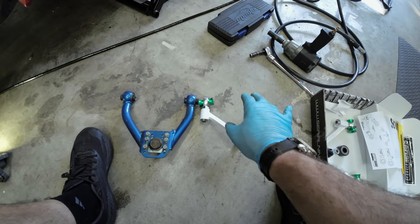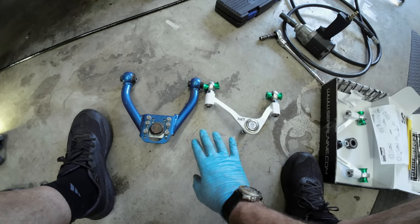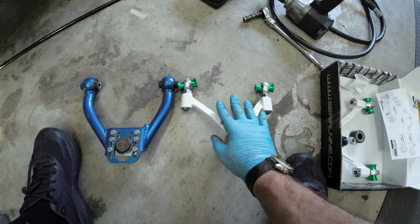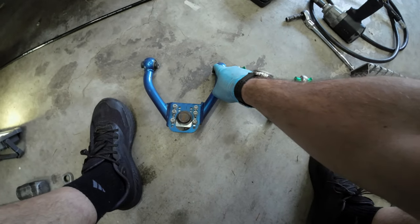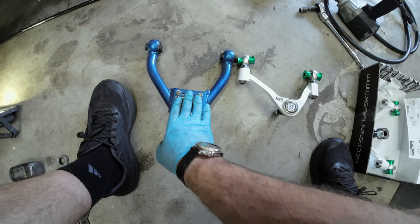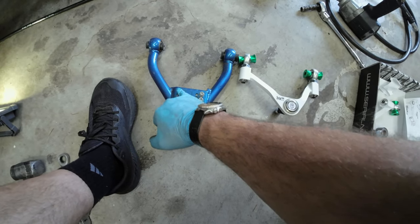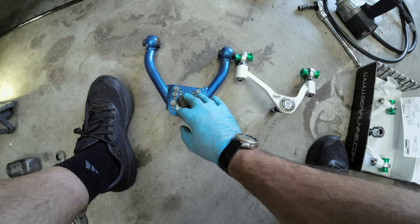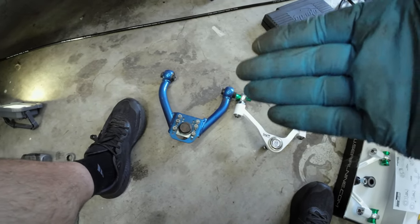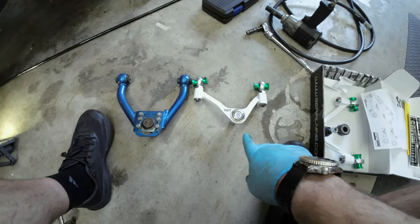The reason why I'm going to measure everything out and want it similar if not identical is it saves me more alignment time when I'm done. The Serial 9's threaded bolt allows this part of the arm to move in and out for extreme camber adjustment. On the Cusco, that part is fixed — it's the pillow ball or adjustable plate that allows you to go super negative or positive camber. I have it on the most negative it can go, all six bolts tight. Realistically, this was not hard to use. Emily and I really thought it was loose and that's why we were losing traction, but there's nothing wrong with the Cusco. The systems are just different. The Serial 9 just looks prettier and is built a little more tough.